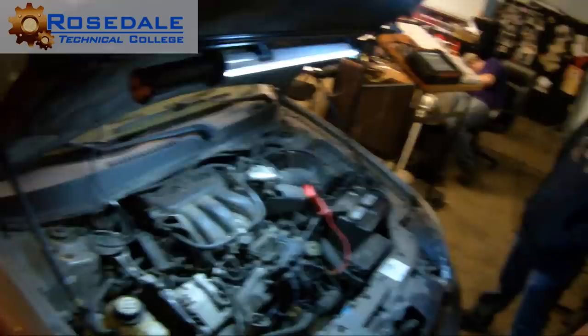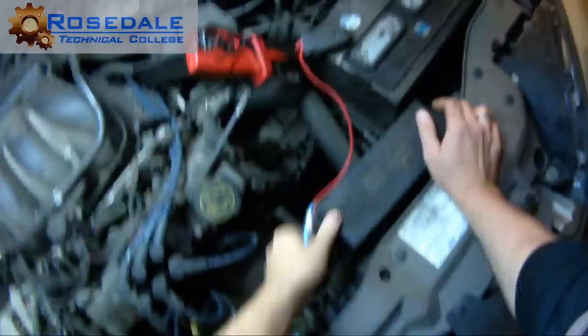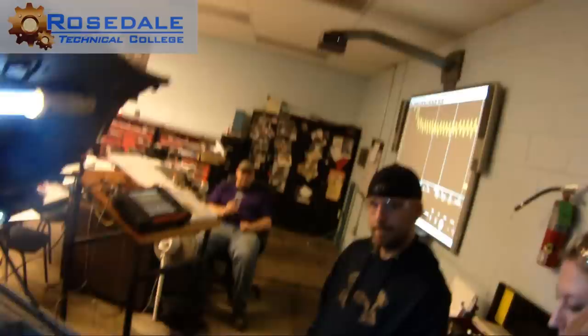Secondary ignition is really going to be beneficial to look at. I'm trying to think of something I can give you while I'm helping them out there and something that will help us. I got it. Look at your wiring diagram and tell me if there's a designated fuse for your fuel injectors. Okay. So what I'm thinking about, similar to what we talked about this morning with the ignition coil on that Ford truck where we can look at all the coils firing at the same time, we can look at all the injectors firing at the same time too, and we can do that from a fuse if there is a designated injector fuse. Okay. We can do that one.